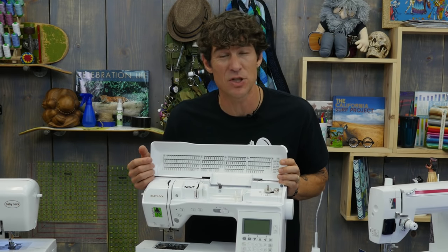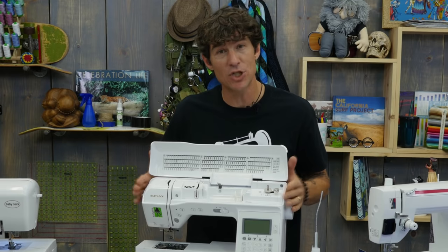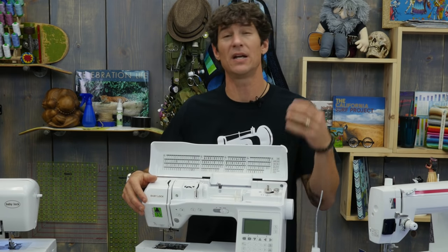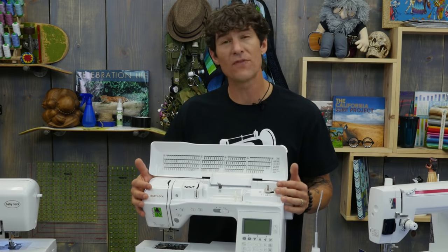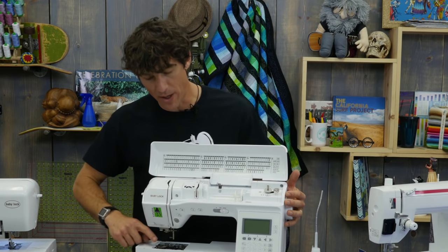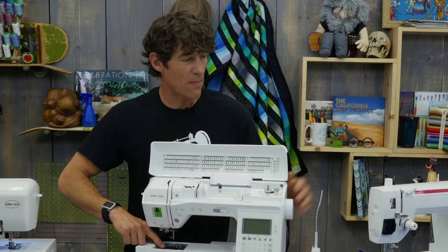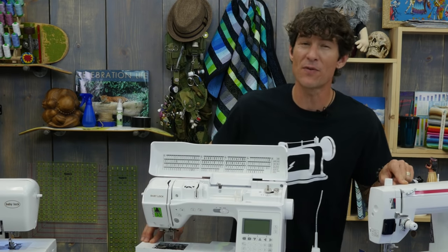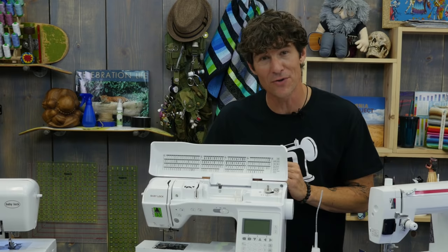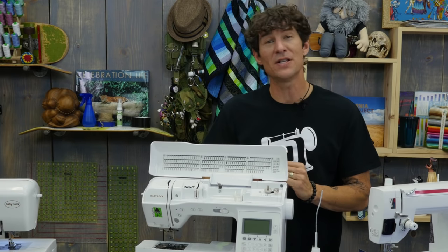I clean sewing machines all the time and I cannot tell you how terrible it is to have oil in the wrong spots. A lot of times I will find a standard home sewing machine where folks will put a drop of oil every possible place they think they can — putting it in the screw holes, in the top covers, all of that. It gets all over and can make a big mess, and there's a lot of electronics inside these machines. That's why I don't want you taking it apart any further. On a machine like this, you're just going to have a drop of oil down in the bobbin area. Older machines may have some oiling ports up on the top. A lot of times on a classical machine it will have a red paint job around that circle — red is a universal sign for where the oil goes. That's something neat to look for especially on an old featherweight.